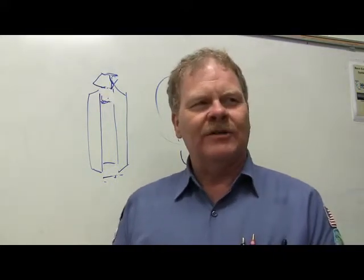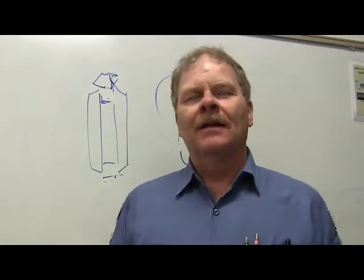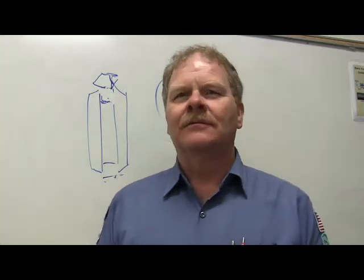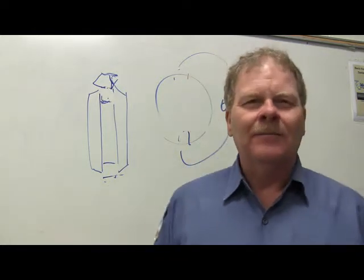All right, I put some synchronizer rings in there that were busted, those little brass blocker rings. Put it all back together. I didn't have nothing in the shop at the time down there at Sabine except for 140 weight gear oil. And I said, well, that ought to do. I mean, we're talking gears here, right? You could not drive that car.